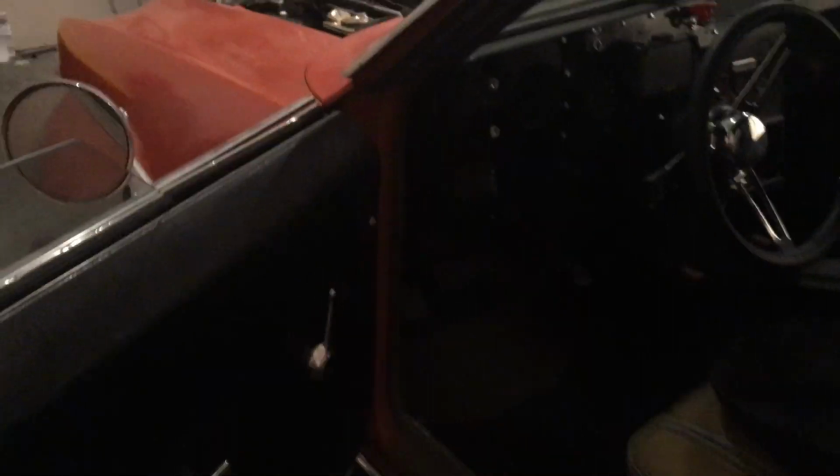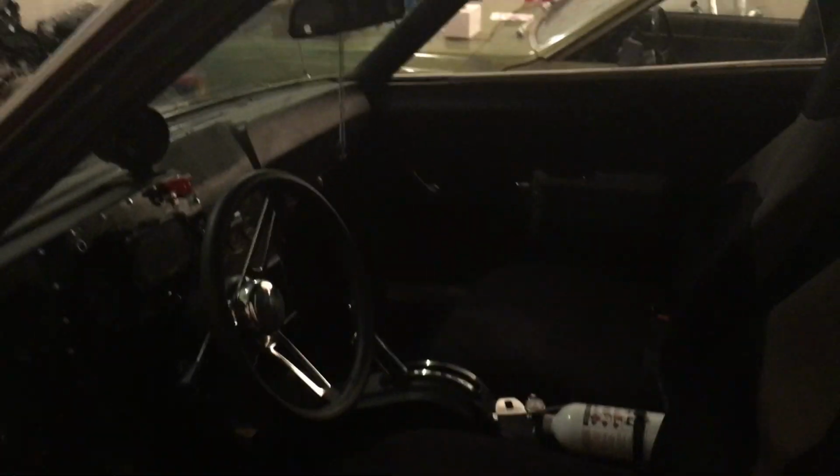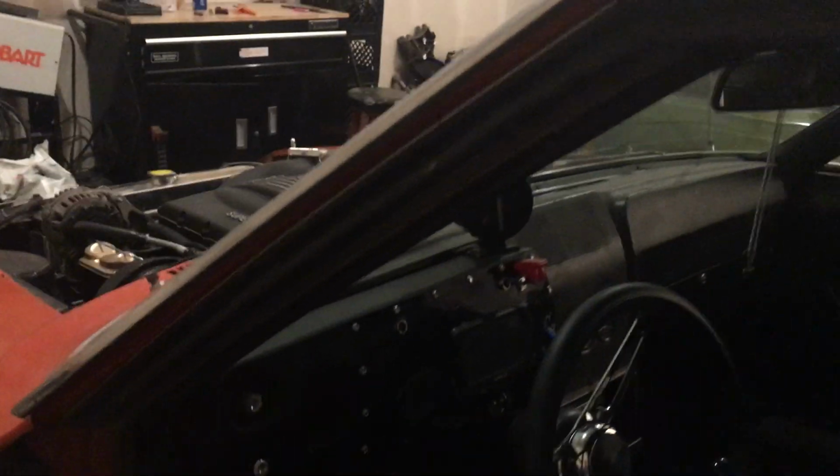A little bit more on that handmade door panel there. We did have the metal tops of some rotten door panels that we took, removed the staples, and put kind of a board, like a quarter inch plywood type of stuff behind there, and just went to our fabric store and got some kind of vinyl stuff and wrapped them in that, and it came out pretty good. I'm happy with it. It does the job. I did get new weather stripping from, I believe, American Parts Depot.